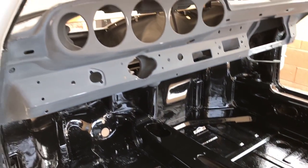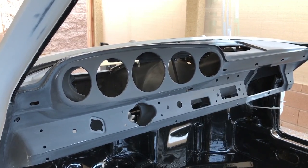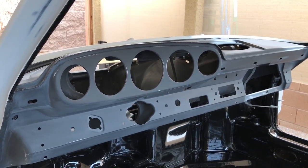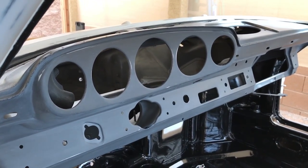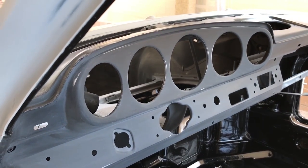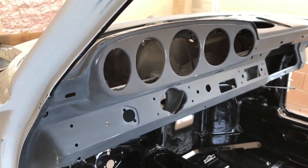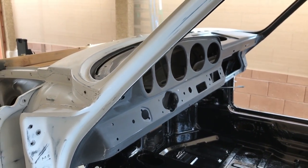The dashboard was shot early in 2016 with an epoxy primer coat in March of 2016. I sanded this up yesterday and I cannot believe how hard this material has cured up — it was so tough to sand. But if you're using an epoxy undercoat primer, you're really going to be happy with the way that thing sets up.